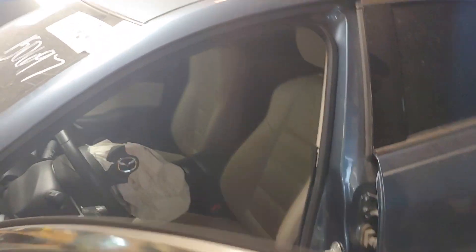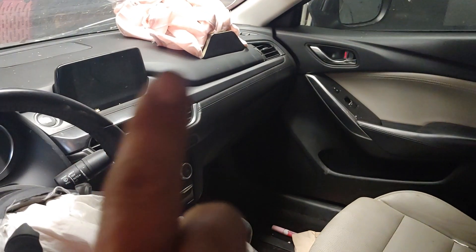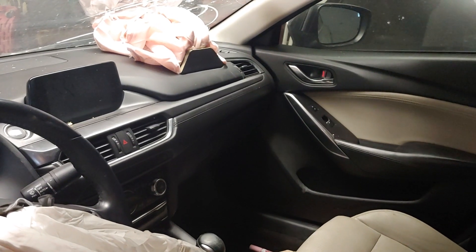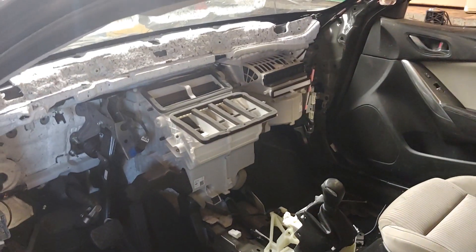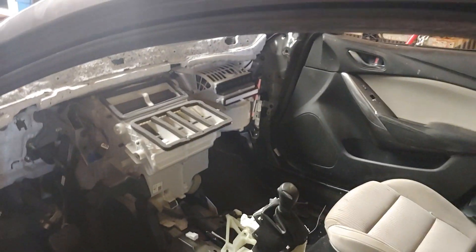Obviously the elephant in the room is this one has the dash airbag out, and it has a spot across the top of the dash — you can see that X pattern. It's actually just like a half-triangle stop sign shape right now, and that ripped when that airbag blew. In order to do that job, which I've already started on, this is how far apart the interior has to come. You'll have to pardon how disgusting the cars are — when these things get wrecked they just throw dry stuff in the interior, but that's how much of the inside has to come out to fix that airbag.